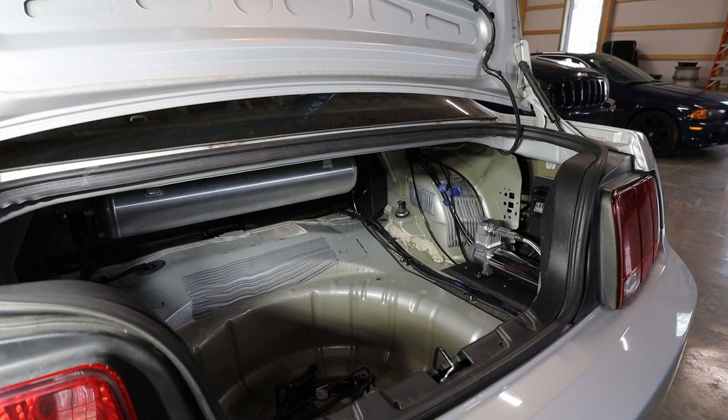So I'll do all that, and then I'll have to run through the calibration process in the controller and check for any leaks and try to get the ride height set to where I'd like to drive, which is probably pretty similar to where the lowering springs had me set at, and go from there.